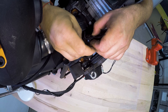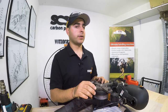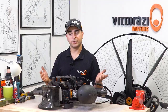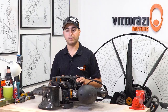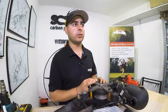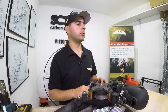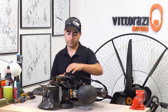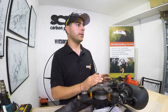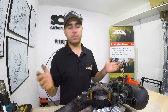We are good to go. After installing everything back together and tightening all bolts to the specified torque, we are sure the parts will work, we will have spark and ignition, and we can go flying. To summarize troubleshooting your spark issue: first, be sure your main switch on the paramotor frame is on; then check that the throttle switch is not jammed in the off position. If those switches are functioning correctly, go to the wires and check the ignition coil. You can check the coil on the engine — just disconnect the wires and spark plug first. If the ignition coil is bad, replace it, set the gap with a simple piece of cardboard between the magnets and the coil, and you're good to go.